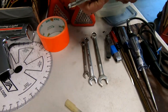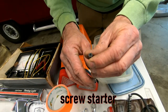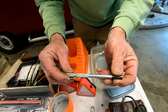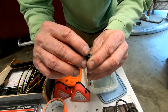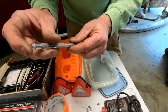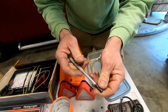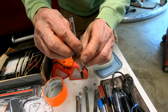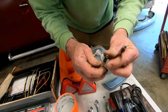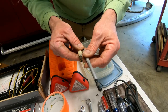Let me show you one of the other neatest little things ever — this is called a screw starter. It is the most wonderful thing if you're trying to put in those little bitty screws on your points inside your distributor, because it goes in there spring-loaded and holds your screw. A magnet works great too, but this is a positive lock that holds the screw in place — you just drop it down in there, turn it in your distributor, and then come back in with your flat blade and tighten things up. We have two of those — a small one and a large one. These little screw starters are really nice and we'll put a link to these for you.